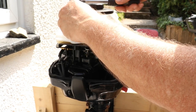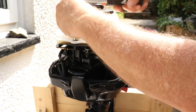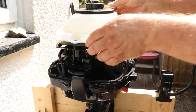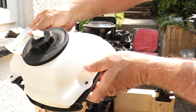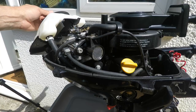The first tip: start by putting a tray or pan below the engine to catch any bits which may fall out. Then use a 10 millimeter socket to remove the three petrol tank retaining bolts. Lifting off the tank and securing it at the rear of the compartment will reveal the carburetor below.